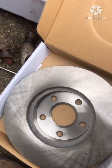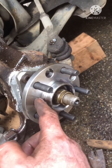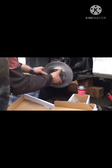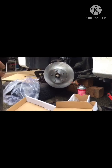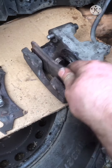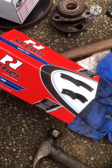Here are the new rotors. I'm going to add some Never Seize to the inside where the metal will contact the hub. That way in the future it won't be hard to get off — at least that's the theory. The calipers are pressed, I've got the brake pads off, and I'm going to add some brake lubricant along the caliper slides.